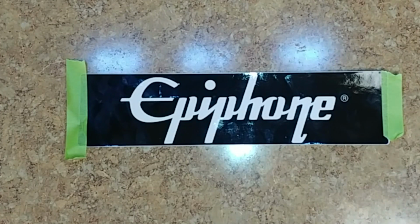So I'm going to go in the garage and I want to start the process of putting these on the back window of my car. All right, so when applying any type of graphic, or any type of peel and stick sticker, or anything that you want to add to your vehicle window, body, or anything else, you want to make sure that it is clean, free of any greases, oils, and waxes, and that there are no smudge marks or anything else on that finish that'll make it difficult for the adhesive to penetrate and stick to whatever surface you are going to apply the decal to.